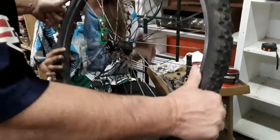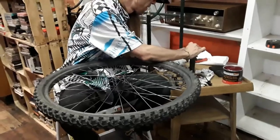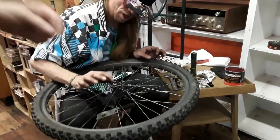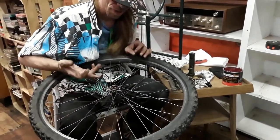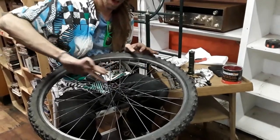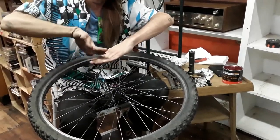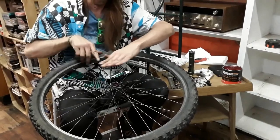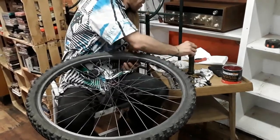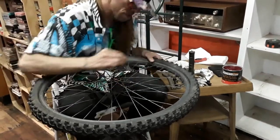Got to clean all these parts up, huh? Yeah. Street gunk. It's all nasty. It'll be clean. So it's just settling the bearings down in the grease. In that grease so it don't move. Now, the way I did the grease is I got enough on there, and I just used my finger to kind of give it, because it's nice and rounded in the race. My finger's coming through and just giving it, like, if there was a corner in there, that would be full. And just enough to hold it and be able to lubricate. 2, 4, what did I say, 8? 8.